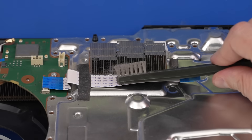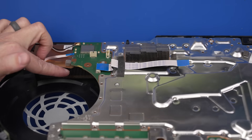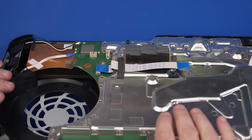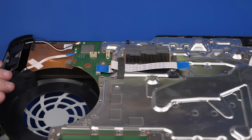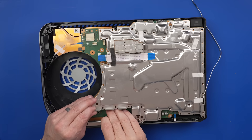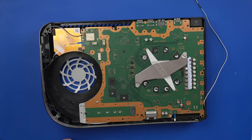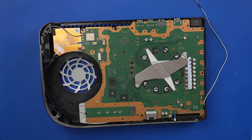You can see all that hair coming off just from that one tiny heat sink. The larger heat sink is down here. PS5s are way more sensitive, in my opinion, to clogged heat sinks than the PS4 was. And since you're already in here, you might as well just give it a good cleaning. Now we can remove this top metal plate, which will let us get down to the APU clamp. Once that's removed and this ribbon cable is removed, we can take the motherboard out and have a look at that liquid metal.